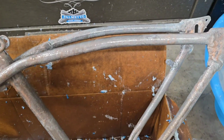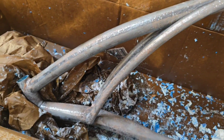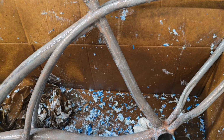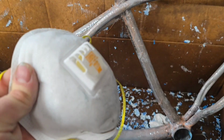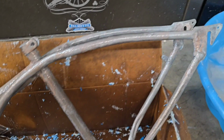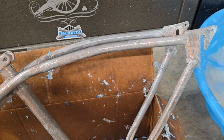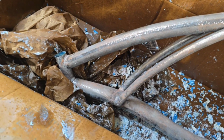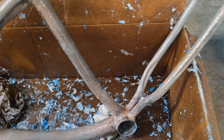All right, here was the last coat that I put on it of the stripper, so it's at work, and we'll let it keep going. And FYI, I know this chemical says it's non-toxic fumes, but just go ahead and wear a mask anyways to protect yourself, because the fumes, especially in an enclosed place, are kicking up in the air. These are what I use. You can get them wherever. It might not be the correct one, but it's some help. Make sure you use some kind of mask when you strip, or use spray paint or any of that clear coat. Save your lungs, trust me.